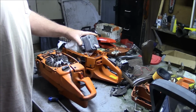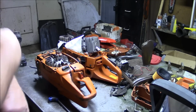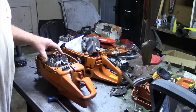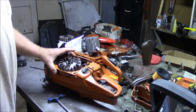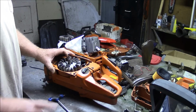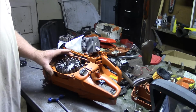I'm not going to go through the review, but I like those saws because they're a little bit lighter. They have a little bit less rotational mass, so they feel lighter when you're running them. And I like these older flywheels on that build, not necessarily the hot rod newer ones, because they have less fins and they're also a little bit lighter. So the whole package just feels a little bit snappier.